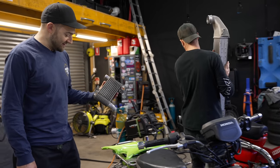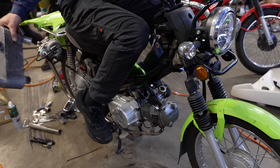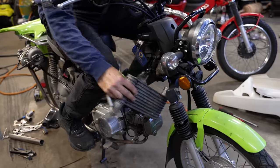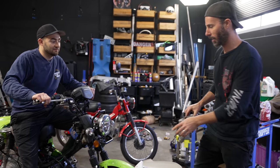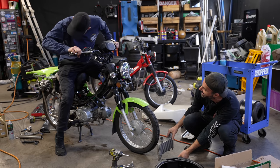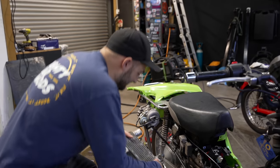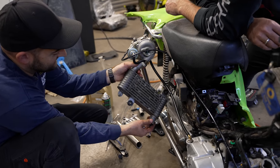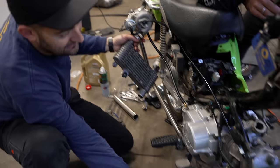That intercooler is big enough for a three-cylinder 0.6-litre — this is a 0.1-litre single cylinder, so it's already oversized. Let's go with that one. Front mounting is an option, but on a motorbike you've also got issues with ergonomics of pipes — you don't want to have heaps of pipes in the way because our legs are here. As cool as it would be to stick it loud and proud, getting those hoses back is not really practical. We're making some mounts and doing this full VL Commodore style. Actually — we're going S-chassis, side mount. We'll work it out, but like — in there somewhere. And then you just go pipe out of here, boom, into the intake.